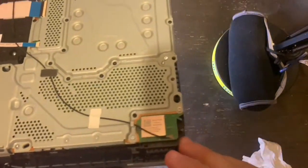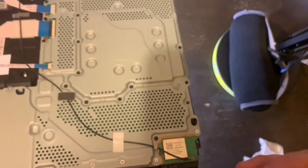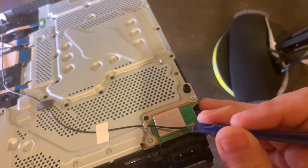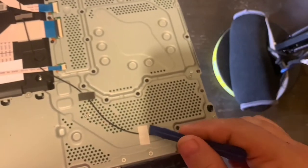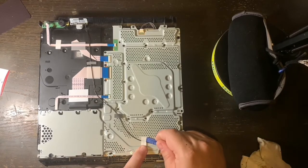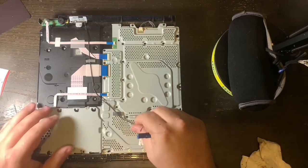The next thing you're going to see is the Wi-Fi adapter built onto the PlayStation 4 motherboard. Take a plastic spudger and disconnect that wire, unplugging it from the motherboard. Then take that Wi-Fi wire and remove those stickers without breaking them. The next step is very important: take a picture of the screw diagram right here so that when you put this back together, you will have a map to put the screws back in.